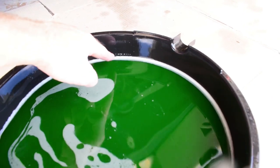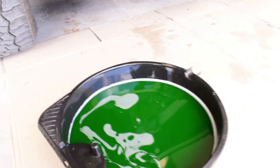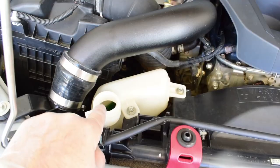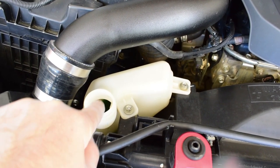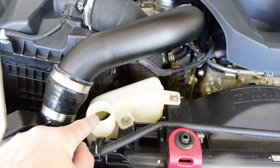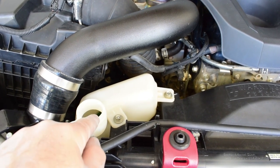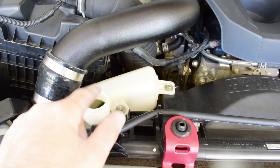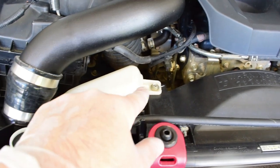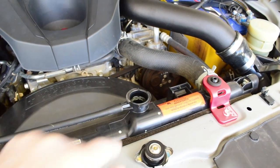You can see we've got maybe 7.5 litres in there, but the system does take 9.5 litres, so we have a little bit of coolant still stuck in the reservoir which we need to drain out. In the overflow bottle there is still a fair bit of coolant left in there. To get this out, you can either suck it out with a suction pump, or you can remove the bottle and drain it out. I haven't got a suction pump, so I'm going to remove this overflow bottle today and drain it all into my drain pan. To remove it, we need to take off these two 10mm bolts and unclip this little hose from the spout.